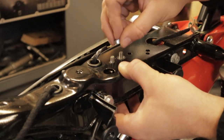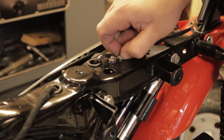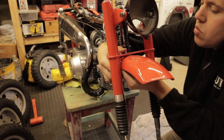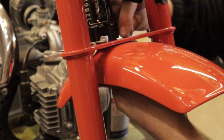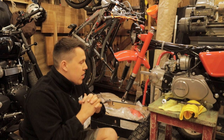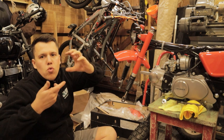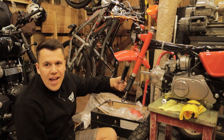We sorted the ground for the coil — maybe a bit overkill but I'd rather make sure there's a good path to the chassis. Sometimes it's easily overlooked, and if I didn't get a spark I'd know I'm covered, so it's good to get it done. Following that I go to the front end and get the fender on. This part could not be bought in the right colour, so we bought a chrome one and had it painted in the right colour. Now we're going to get the front wheel on the bike. I've noticed the fork springs are rotational — they should bottom out but don't always fall in the best position, so one fork leg is turning into position slightly. I think everything is locked in place by the top bolts and caps, so hopefully that's not an issue — first time doing one of these so learning as I go.